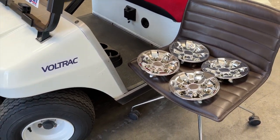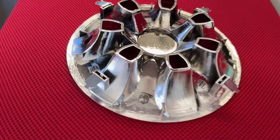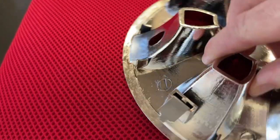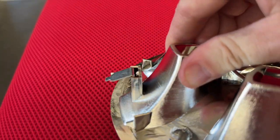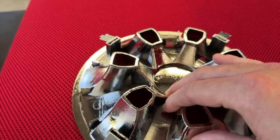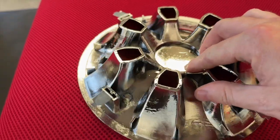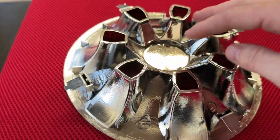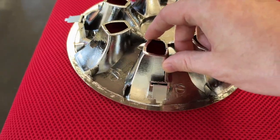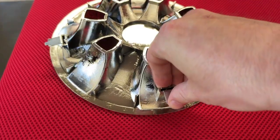What you're going to find here on the back are these metal clips. When they're straight like this, it's going to be very difficult to press the hubcap on, so you're potentially going to damage your wheel or even break a clip if you try and force it on. What you've got to do is bend these clips in.